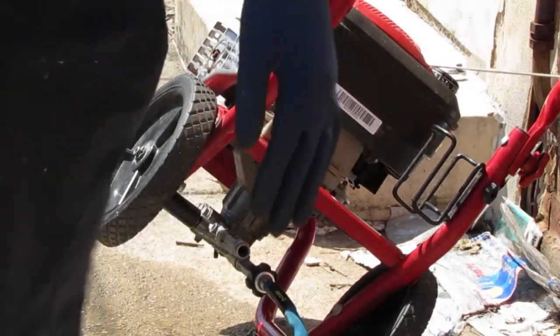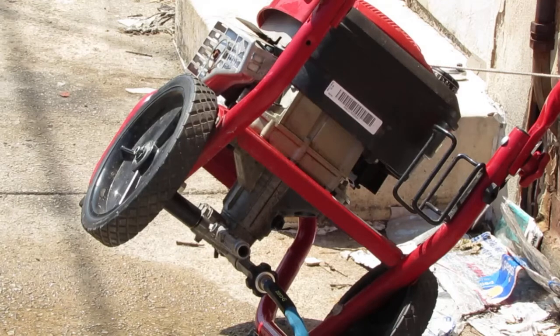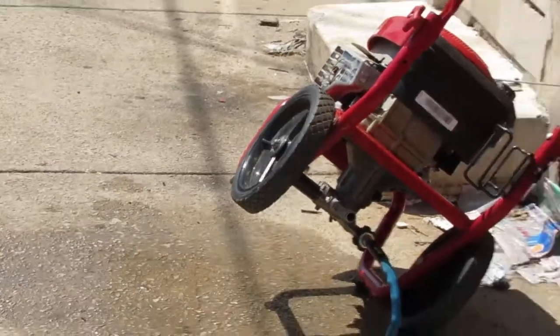That's me tightening it back up. So I think that pressure release valve has failed. That's what I think is wrong. It's not moving, so it's not allowing water to get by, and it's not allowing it to build up pressure, because it kind of closes the system off and water loops back. I'm sorry, you can't see what I'm talking about.